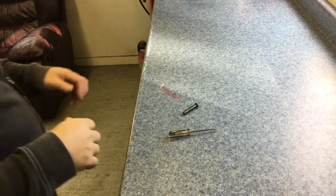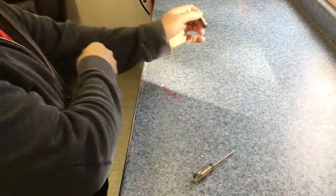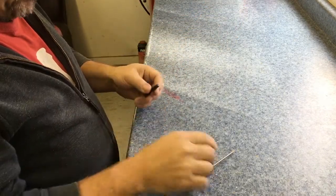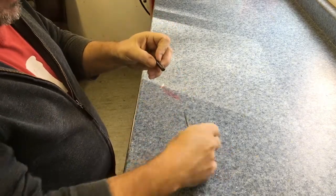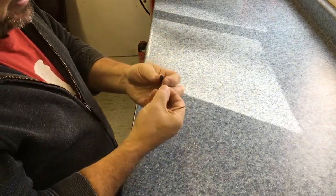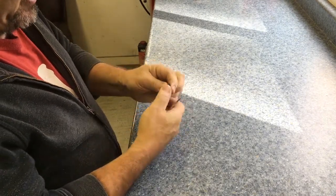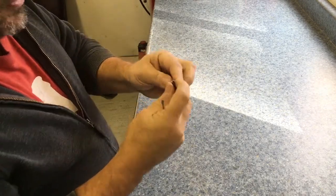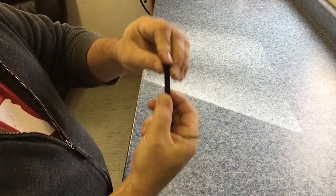So for anybody that hasn't removed the doors before, there's a couple different ways you can do it. There's 4 bolts that hold the hinges onto the machine. That's one way. Or there's these pins that pop down in the hinge, and they just have a little E-clip on them. The E-clip slides over the hinge in a little groove, okay? And that stops the pin from coming back out.